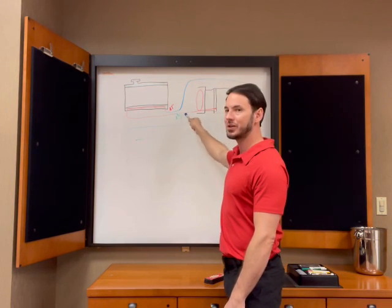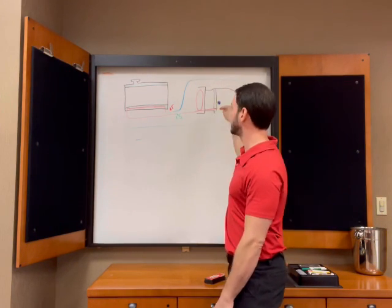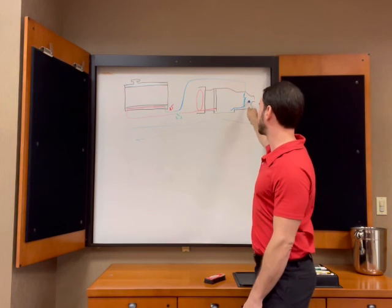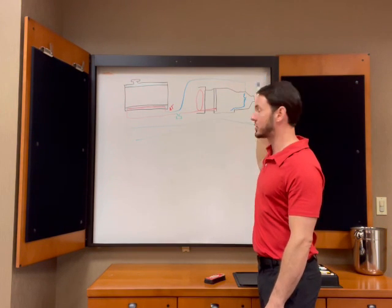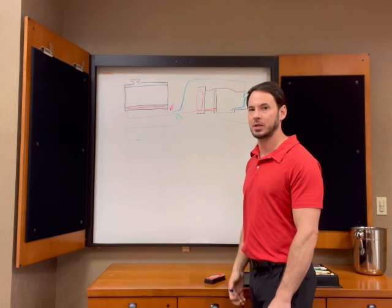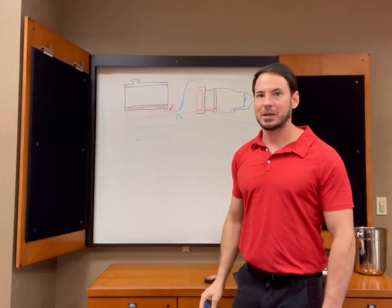The one thing I will tell you, you've got to remember: if you restrict the flow through here, you're not going to get any kind of warning lights, you're not going to know anything's happened, but you'll seize this bearing and it will destroy the transmission. It's nasty what it does. The whole planetary will get seized up in trash. So, I think I about beat that horse.